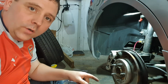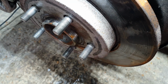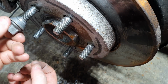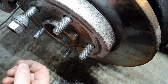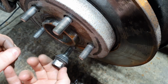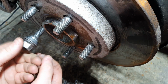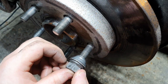But what I'm going to do is move the camera and show you how to do this. So this will be a quick video. Okay, so we're at the wheel. The bolt goes nicely on this one, just to show you. Nicely on this one. It does get a little bit tight, but that's fine. It needs cleaning up. Goes nicely on this one, and these two it doesn't. Watch, I'll show you. It's because the first couple of threads at the end have been damaged.